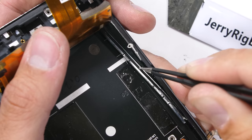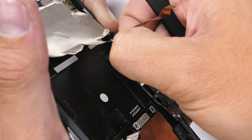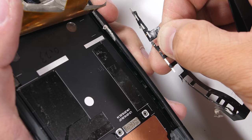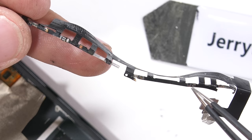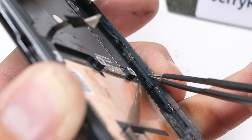The ribbons run along each side of the phone — each side is essentially the same. I'll pull off this long plastic protector and start working on removing the ribbon. The problem is that HTC has permanently adhered the ribbon to the frame of the phone, making button replacements or squeeze motion replacements impossible without replacing the whole frame anyway. Even while attempting to be gentle, my ribbon was torn and portions of the contact pads were left attached to the frame, rendering my phone unusable.